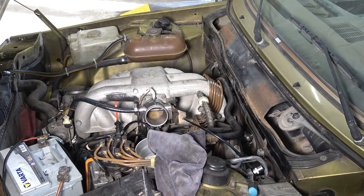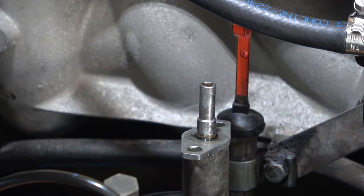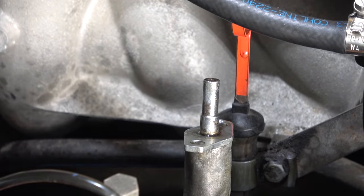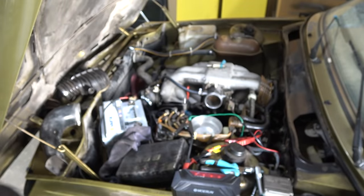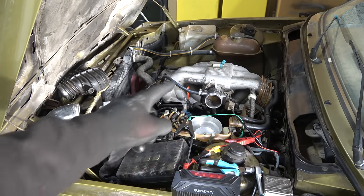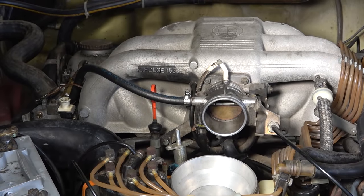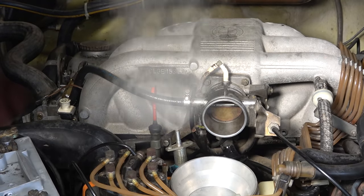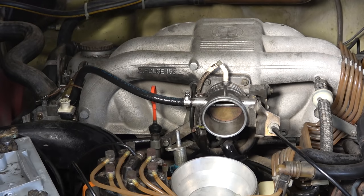I replaced the diode relay and the injector is finally getting power. That said, the injector itself is bad — third or fourth I've tried — it's dripping but not spraying properly. The relay was definitely the culprit preventing power from reaching the cold start injector. I need to search eBay again. A subscriber then dropped off one he had in storage — also not working. Say hello to yet another cold start injector — fifth or sixth. Let's see if this one works properly.